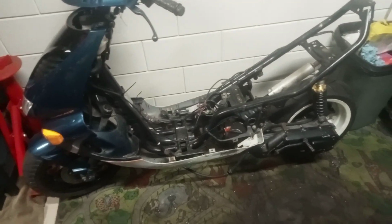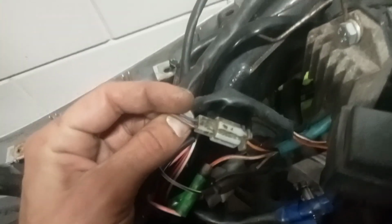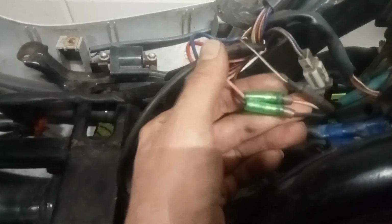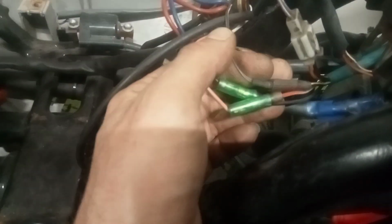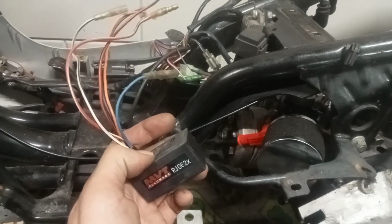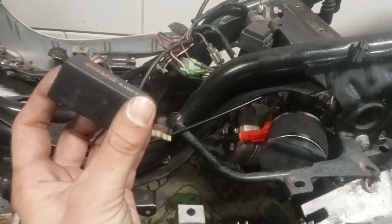Yeah, so I tried to see if it sparks over there. I have it connected the way I think it should be connected, because this plug only can go one way, and basically everything only can go one way. Because you got the black-red wire on black-red wire, but this pink wire, I'm not used to it being pink, so it's confusing. Also, I tried this CDI, and then I saw one spark after I put this on, only once, so it's a bit confusing.